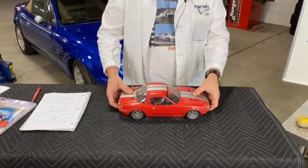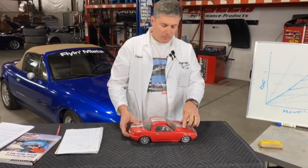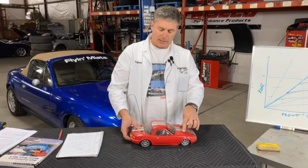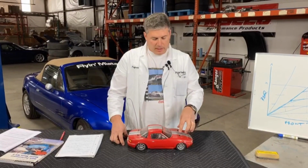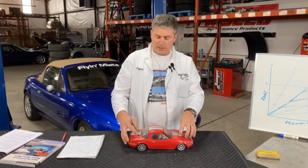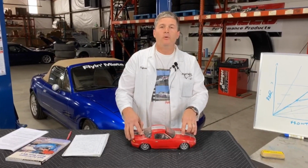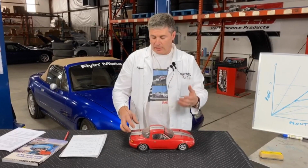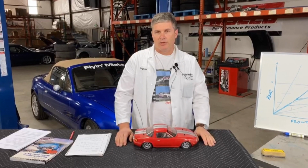It's also related to how quickly you're decelerating. The harder you're braking, the harder you're decelerating, the more transfer there is. And you can see it when you look at a car. That body movement is the reaction from weight transfer. So if you're on the track with sticky hot race rubber, you're going to get a lot more weight transfer than you will if you're driving around on a cool fall evening on street tires. And so your ideal proportioning will adjust for that if you want the perfect proportioning.